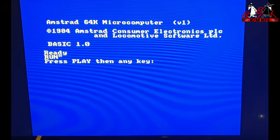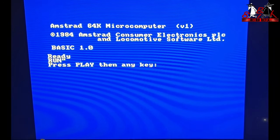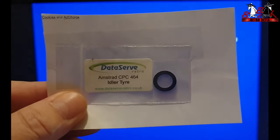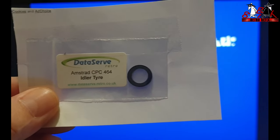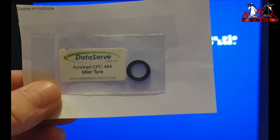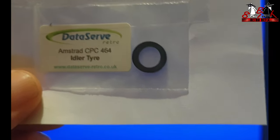I've set the microphone up the side of the Amstrad just to let you hear the sound of the loading sound. What we're going to do is repair it, and I believe it's the idler gear pulley rubber o-ring - one of these, and this is from Data Serve. I'm not being sponsored in any way by Data Serve, but I've used a lot of Data Serve stuff for tape decks - spectrum tape decks, Commodore tape decks. They do all sorts of things, so they are on the internet. If you go on eBay and search for Data Serve you'll find them, and I'll put the address and a link to get these belts down in the description.